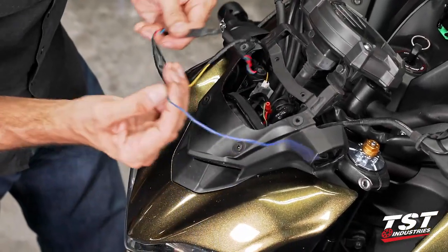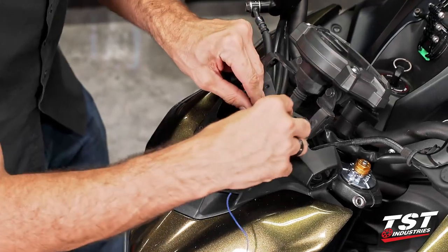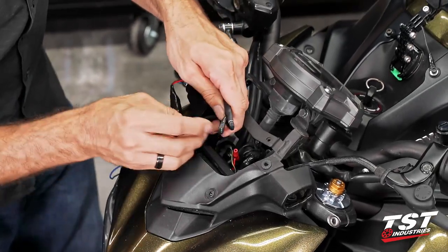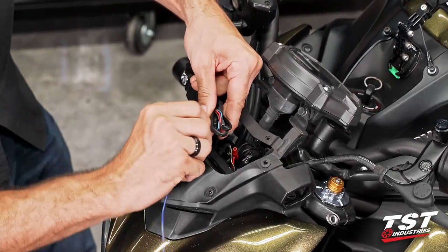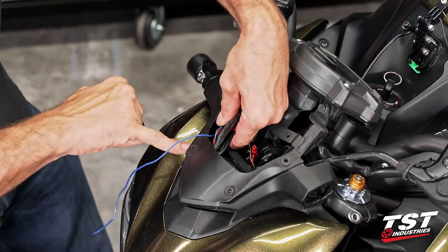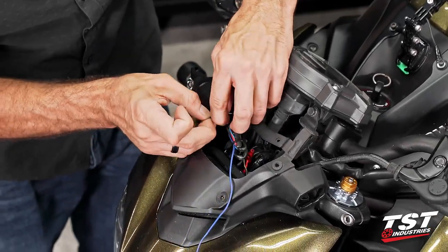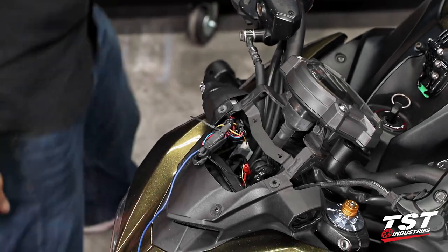I have to figure out how much length of this wire I need. It's very important not to stress any of these components — there's a circuit board in there, and if you break it, you will damage the function of your signal light. If we overlap all of these wires together and get a nice low-bulk package and put it right under here, that'll be retained by the windscreen. Do not stress that circuit board even in this configuration — you just want to get the wires bunched up and retained.